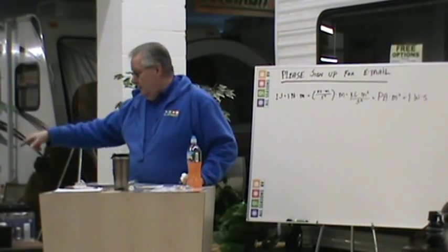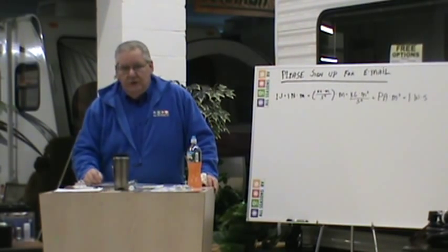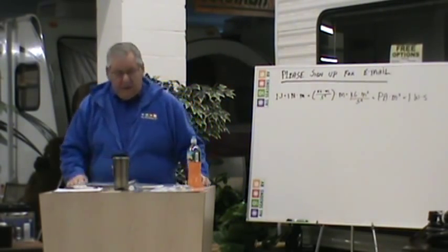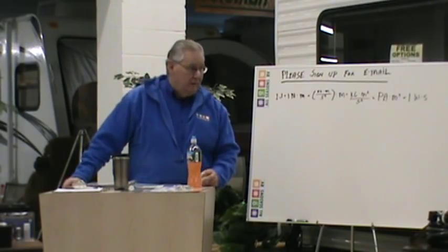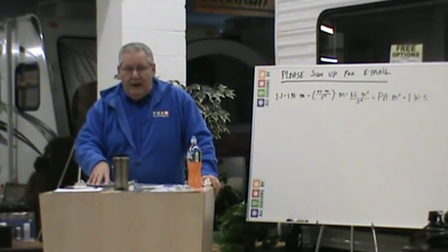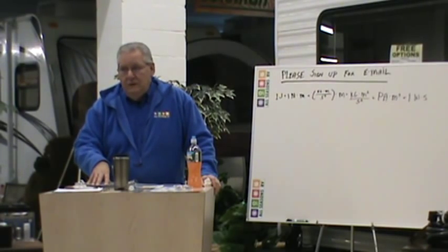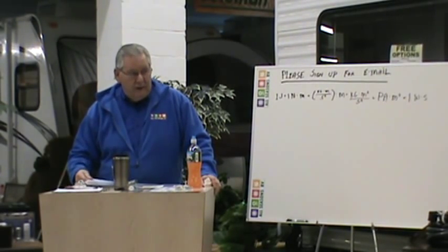Now, if you do plug one of these little checkers in and something isn't right, what do you do? Just plug in and go? No, you don't. You have to report it to the office at the campground. Tell them that you're not getting the ground. Tell them the neutral's not right. Polarity's reversed, whatever. Or you're getting low voltage. With low voltage, you can ruin your air conditioner. If the compressor kicks on at 109 volts and starts to run, that's not enough power for that air conditioner. So you can damage the air conditioner, and you can damage other electric appliances.